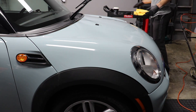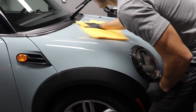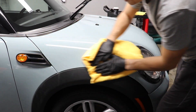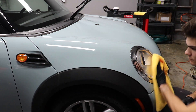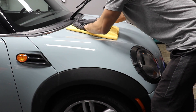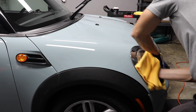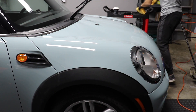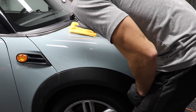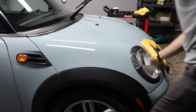Then I get my first microfiber. Generally I like to use the low pile side and I'm going to buff it off during my application process, kind of let that sit for a sufficient amount of time. First application — super easy to buff off, nothing crazy. Sometimes you'll find that certain coatings are very, very difficult to buff off, and this one is definitely not. But it says if you have any trouble you can use a little bit of water or a damp towel. Now I'm going to take my second microfiber — I normally use the high pile side. I can just buff in circles. People say don't do circles, you're going to get swirl marks — well, that's only true if there's something in my towel that I don't want to be there. I'm going to go ahead and do the rest of the hood.